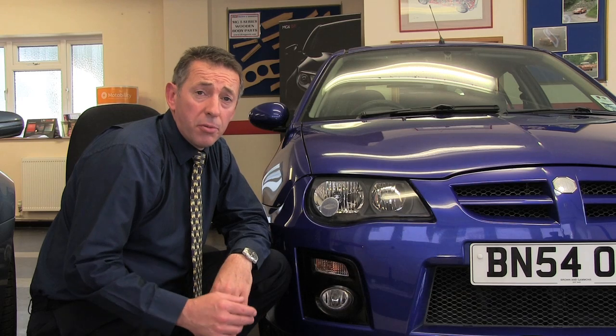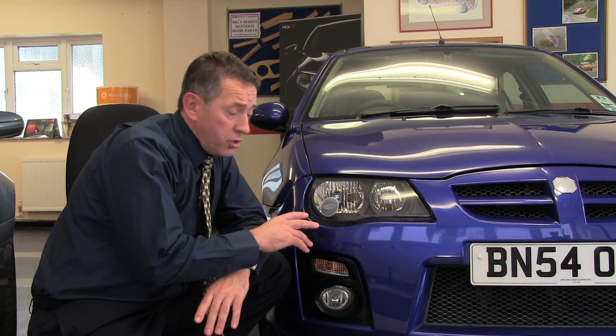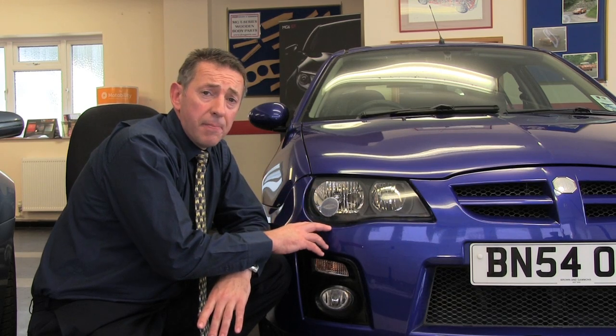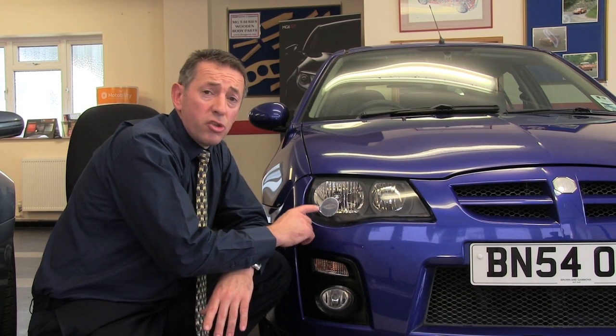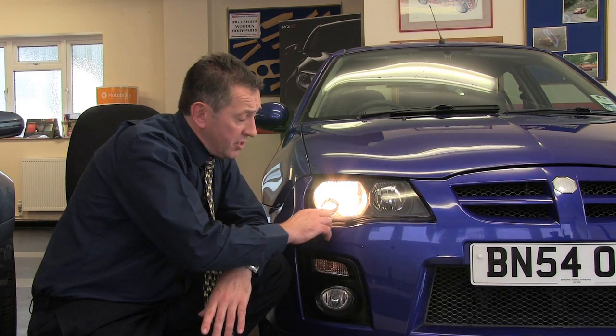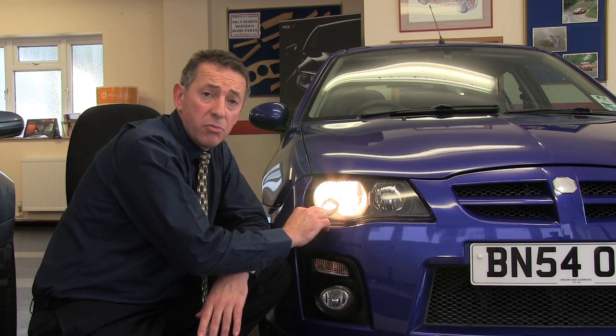We're now back from our trip to Europe and we want to take the headlamp adapters off our lights. First thing to do is always remove your adapters immediately upon your return to the UK. The easiest way to do this is to switch on your headlamps first for a couple of minutes, which will allow the warmth in the headlamp to soften the adhesive up and assist its removal.